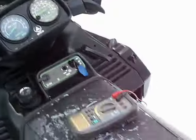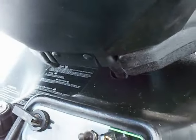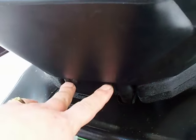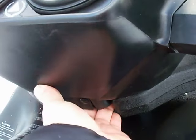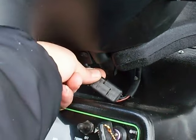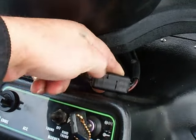Anyway, to keep that kill switch, we're going to get our meter, turn it on, and locate our three-prong wire. Blaine talks about them being up in here sometimes, where you have to take these two buttons out — there's two on the other top side — and then this part comes right off the gauges and you can get to those wires. Mine happens to be down here already because when I had my sled apart before, I took the factory zip ties off and made this accessible just in case this problem arose in the future.